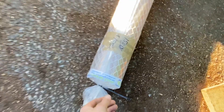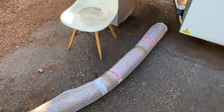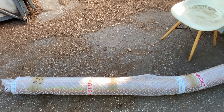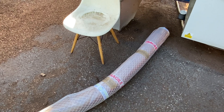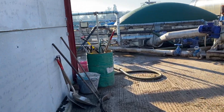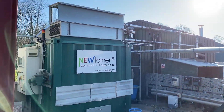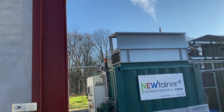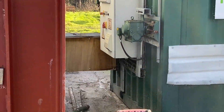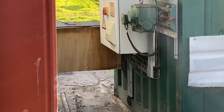I've got a roll of tubing here which is six inch and I said it was 15 metres long - doesn't look it there. I'm going to try and use that to recycle some of the hot air out of my dryer and back over the heat exchanger, just to try and maximise the amount of heat - or increase the temperature inside the dryer I should say. I'm going to put the pipe in at the top there and then run it along the edge, so the hot air gets sucked back over the heat exchange box and back into the dryer. Well, that's the plan anyway.